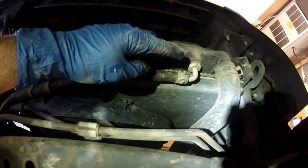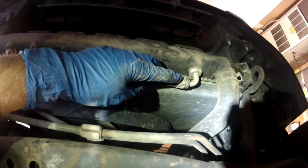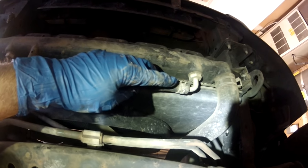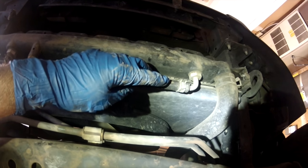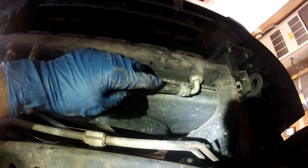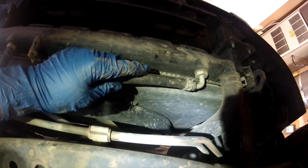What we're going to do is remove this fitting, stick another hose on, and this is how we're going to flush the old transmission fluid out of the system. We're going to turn the vehicle on, drain a quart out, stop, fill - put a quart in the dipstick tube. We're going to keep repeating that till we get clean transmission fluid coming into our catch container.